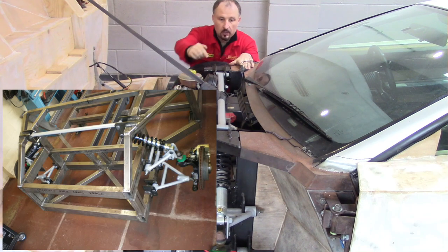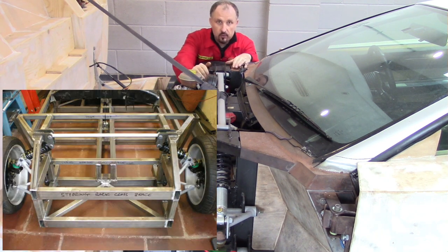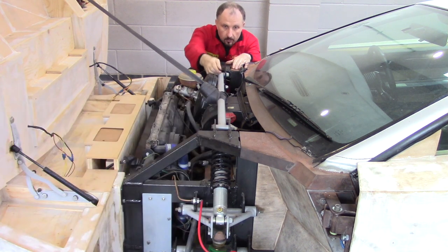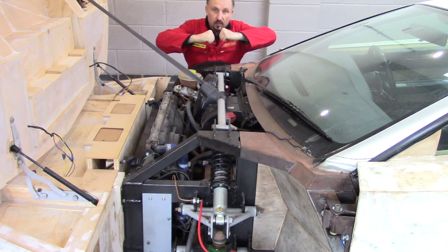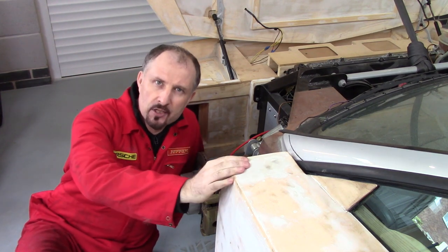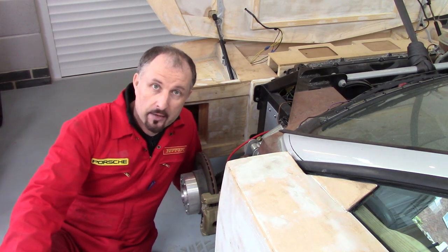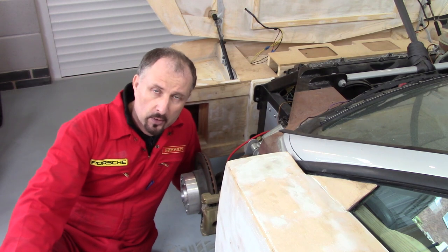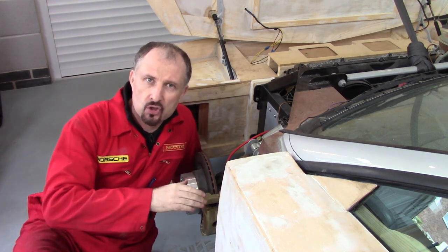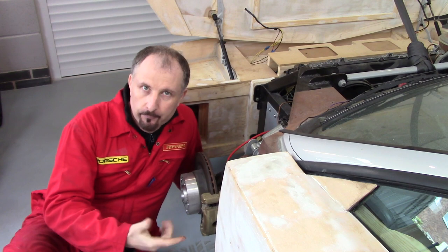While we're here, we can take a closer look at the front suspension. You may see this strut brace — I'll put this in to add even more strength to the front of this car. The shock absorber strain or g-force is then pushed through this strut brace to the shock — it's a very strong system. In the back of my mind I'm always thinking that if I ever finish this car I might be able to turn it into a kit for the open market, so I have to try and keep the cost down and make sure everything I design can be replicated cheaply and easily.